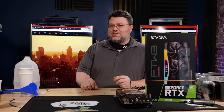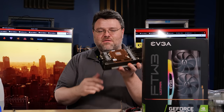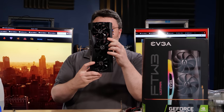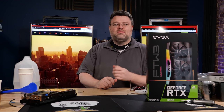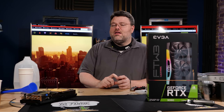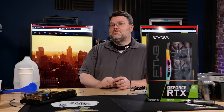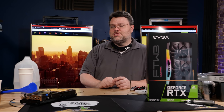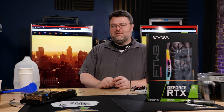In 67 easy steps, you can go from a perfectly good high-end 3080 with a perfectly reasonable stock cooler — and there was no reason to replace it because it is an awesome cooler — to a whisper-quiet, shockingly quiet water-cooled SFF system. I had to bleed a little and made a bit of a mess, but the system works well and I am ready for Alder Lake. I was able to overclock the CPU to 5.2GHz all-cores all the time without exceeding 75°C. Impressive.